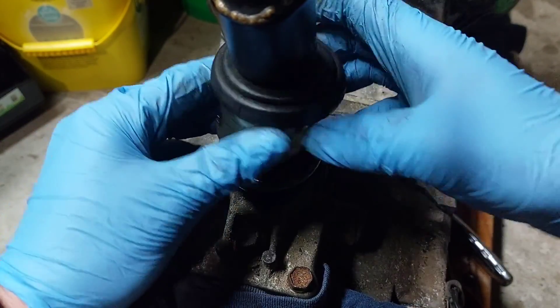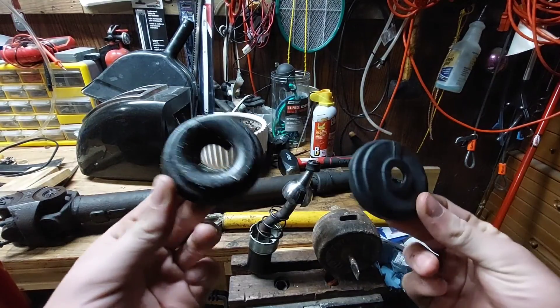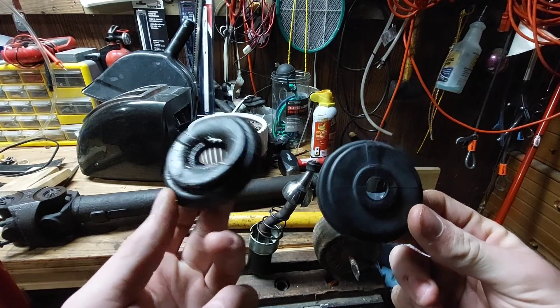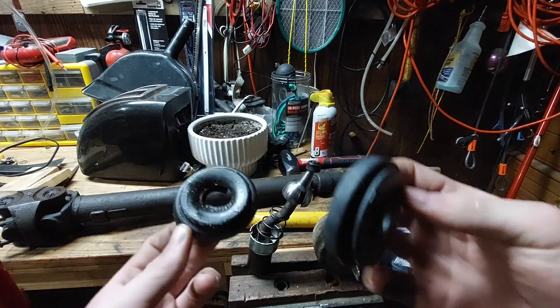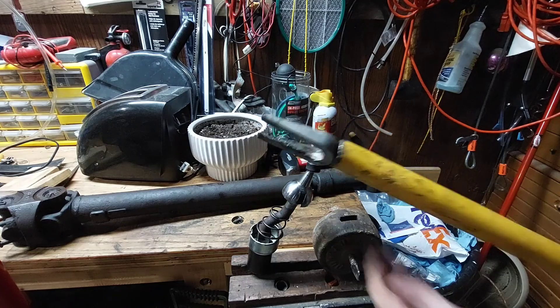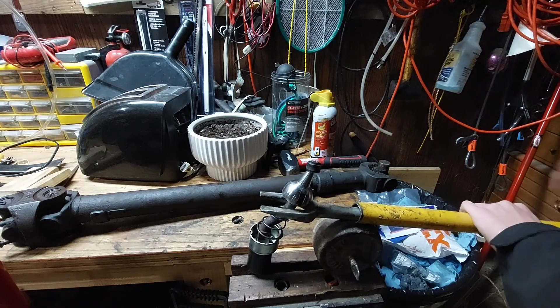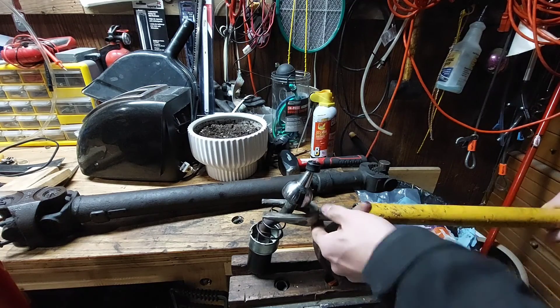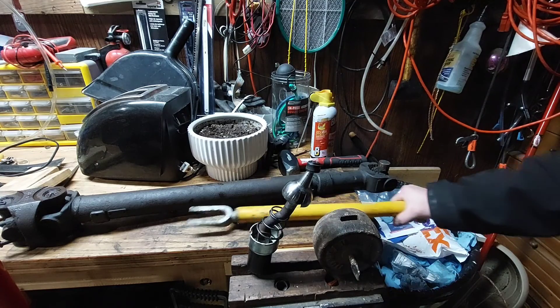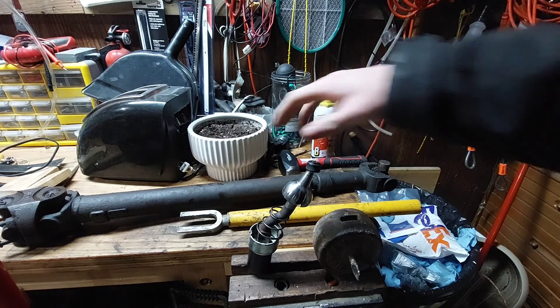During some inside days I tried to replace the seal that goes on top of the hole the gear lever goes through. After getting that off, I needed to replace it because — just look at it. In order to get this off you have to take the gear lever apart — it's in two pieces and you have to separate them, which was really hard to do. I took a pickle fork and a cheater bar, wedged it against the lever, and hit the end with a sledgehammer repeatedly for about 10 minutes until it finally came out.